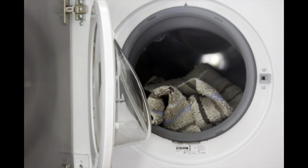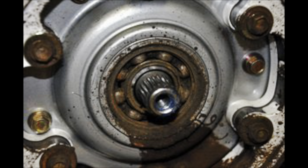I'll often have to come to someone's house and unfortunately let them know the machine is so damaged due to the heaviness of the bathroom mat that it's basically beyond repair. What happens is the bathroom mat absorbs so much water that during the spin cycle — going about 1200 RPMs — there's so much sideways centripetal force on the rear bearing that it wears it out. Then the spin cycle becomes so loud you can't even be in the house.